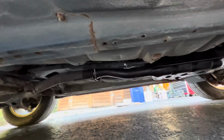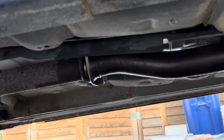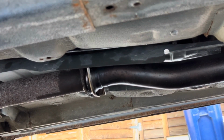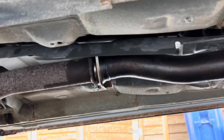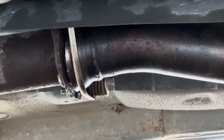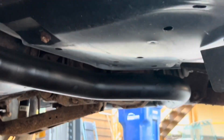The doughnut gasket here is the same size, everything. I don't know if it's the same part number, but I bought one for a 2010 Forester and it worked with the STI exhaust. Replace all these bolts. I didn't replace the springs, but the bolts were all seized. Fitment is real nice. Factory fitment.